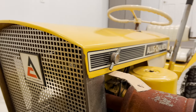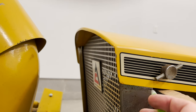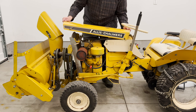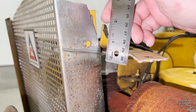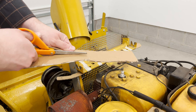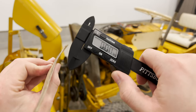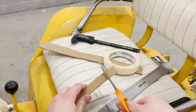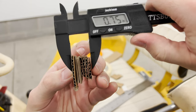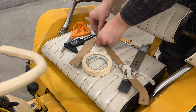Right away we can see the bracket needs to come down — we don't want it up against the hood. Now we have to measure how much this bracket needs to come down. Allis Chalmers achieved this back in the day with two simple bushings: the bolt would go straight through and you'd put a nut on the other end. I'm going to represent this space with — you guessed it — more cardboard. You might think this is silly, but it's going to do the job. And here they are: my bushing representations.